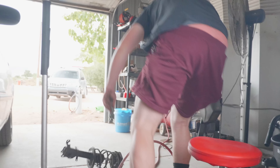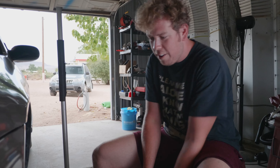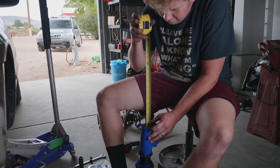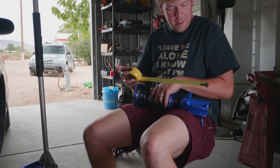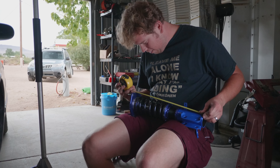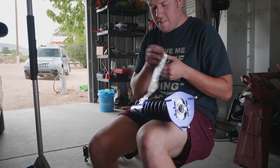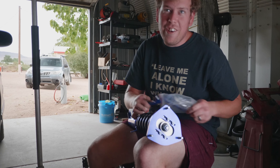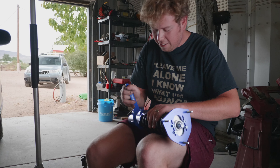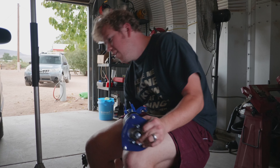Stock one's out. I'm just choosing a ride height — whatever we do here doesn't mean anything final. So just choose two arbitrary points and make it the same for both sides. Fourteen and three quarters. This is all adjustable — it should all be adjustable when it's on the car. I just don't want to put this together and then have the two sides be completely different.